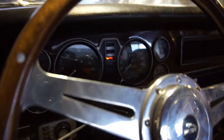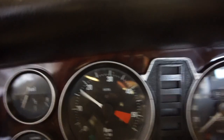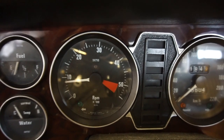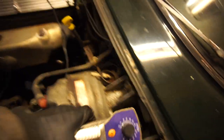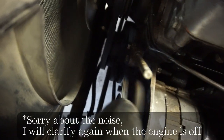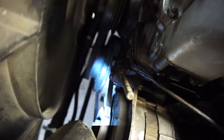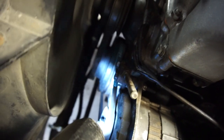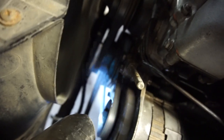Hopefully it's going to fire right up. Just give it a little rev. It's about 800 RPM — that's pretty close enough to 750. I'll grab my timing light and set it to zero to start with. Hopefully you can see the timing mark there on camera. Looks like it's at about 6.5 degrees, so I'm going to turn the dial on the timing light so it goes to the zero mark.